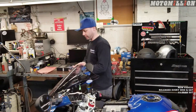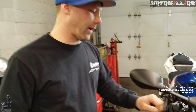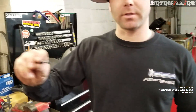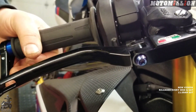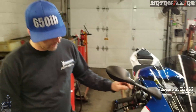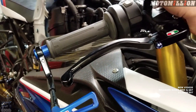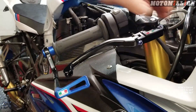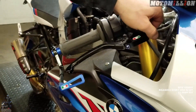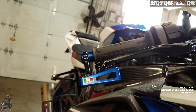While we've got the bike down, we'll go ahead and put the TWM levers on next. Got our brake lever on — it uses the factory mounting bolt and comes with a new little piece that pushes on the master cylinder. You need to use the supplied one; the factory one's too long. It's easy to adjust — just turn this knob and you can watch the lever moving closer to or farther from the bar, so you can adjust it for your hand size. It will fold if it hits the ground. Looks like we may have to adjust the brake lever guard up just a hair.